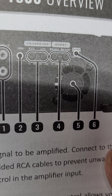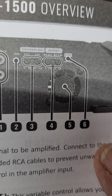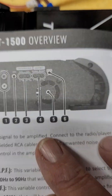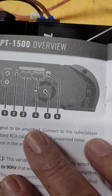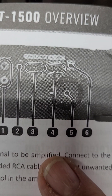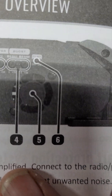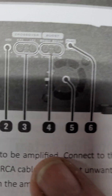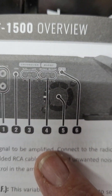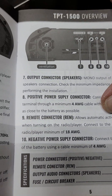The high pass, which is like a subsonic — 10 to 90. The low pass, which is 90 to whatever, 15k or something. So this can be used for subs, mids, highs, whatever. I'll wind that all the way down to 90 for the high side of the low pass filter. And then you've got a switch, flat or off. I think this activates these two boost controls, like bass boost for mid-bass or mid-high, but I'm not using it for that so I'm not really going to get into it.